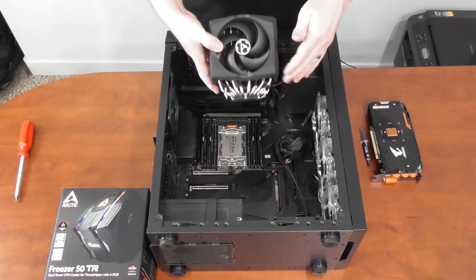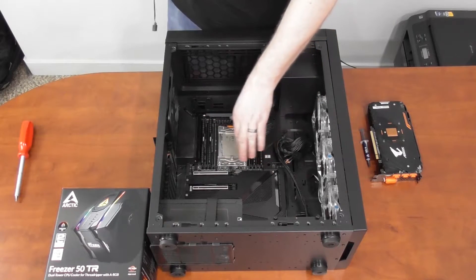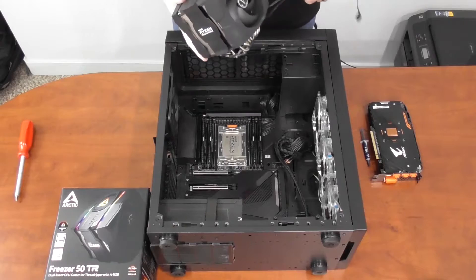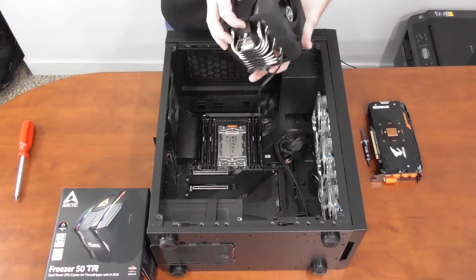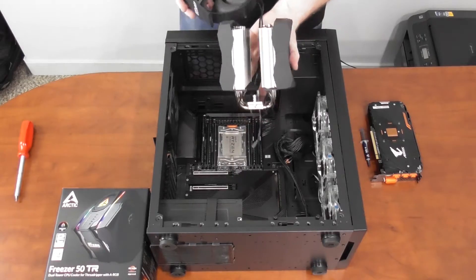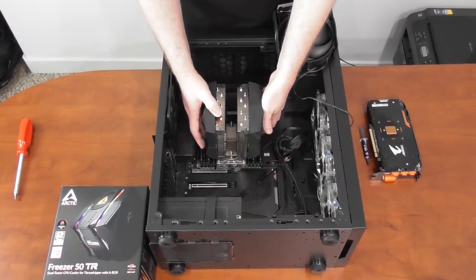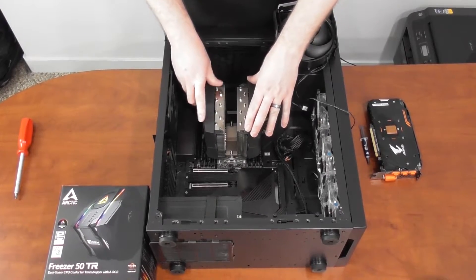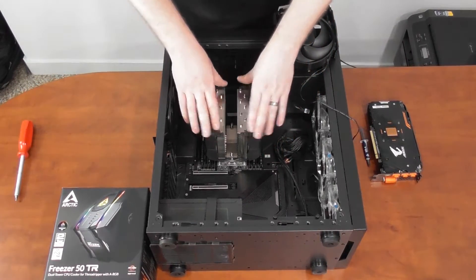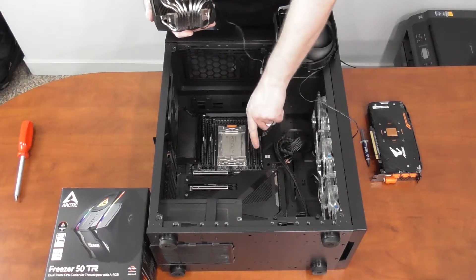Because of the slight V design, this thing doesn't have a whole lot of clearance for RAM. We had to take our Sniper X RAM out and replace it with these Corsair Vengeance in order for this to actually fit. There's a latch here and here to separate the fan. If we dry mount this right here you'll see there's no wiggle — it'll sit and clear our sticks of RAM just barely. So be sure you measure your RAM before you purchase this, because there's not a whole lot of clearance. These are pretty low profile DIMMs.